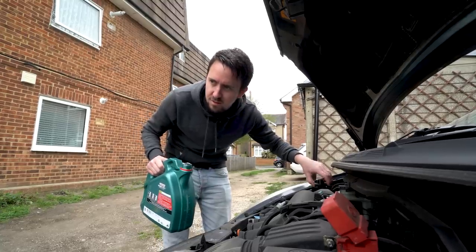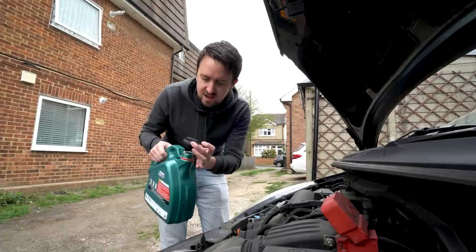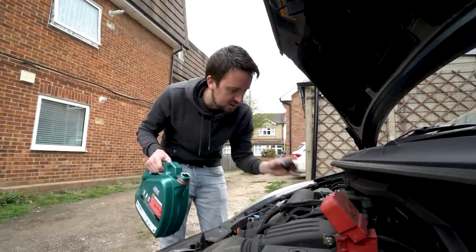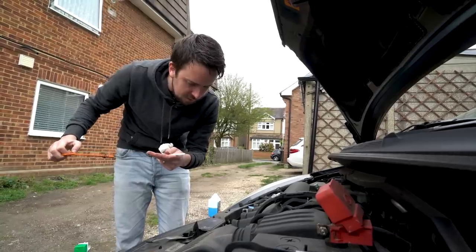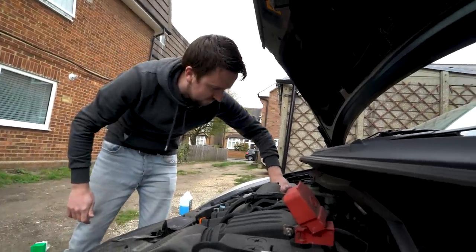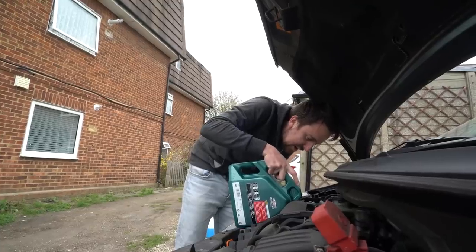Well, I'm just accounting for a lot that was spilt. That doesn't go on there, by the way — that goes there. Have a look at your dipstick. What's it saying? It's about halfway between them. You want it just above the top. You two are actually making this so much harder. And your sump plug's in for sure, yeah? It's on the dot. Job done, Ethan — you've changed your oil.